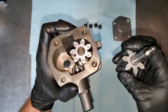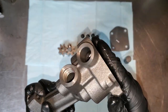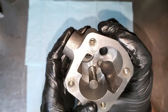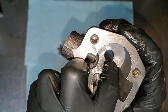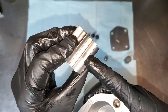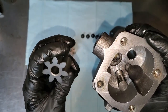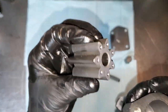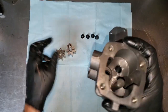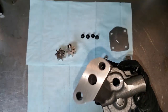I finished my visual inspection and also called David Butler at Butler Performance. We went over some details. This is the latest generation — they've had several iterations. Some older iterations had an oil groove in the bore, oil groove holes on top of the idler gear, and a weep hole drilled in the middle. Those changes have gone away based on customer experience and hundreds of units sold without failure. This one is now cast, so if you try to drill it, it's going to shatter.